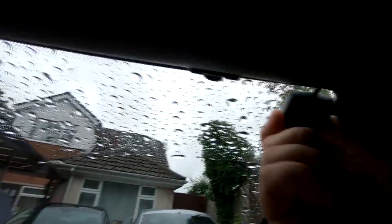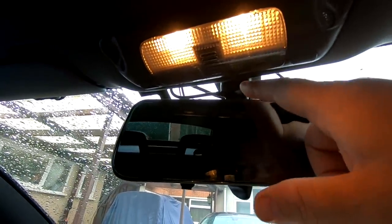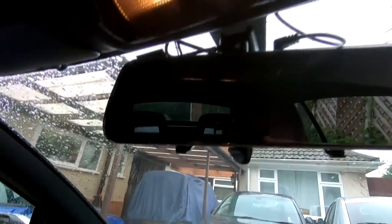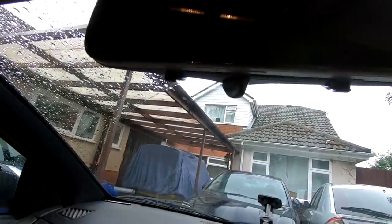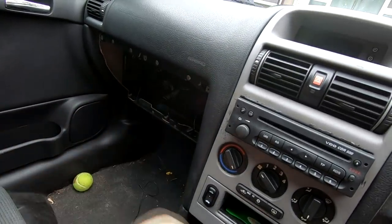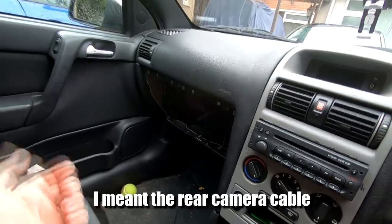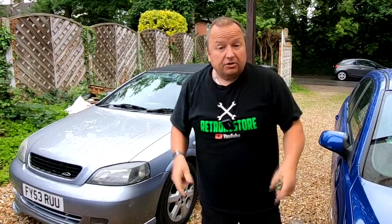Coming up here — the GPS module — I've just put that up there and it sticks under the top cover. The rest of the cable, which is the power lead and also the rear camera cable, goes along and down. The power lead comes through the glove compartment and into there, and the rear camera power lead goes right the way down the back trim to the rear of the car. So let's go inside now and I'll show you a bit of footage we took yesterday when we were out driving — a few little things happened as well.